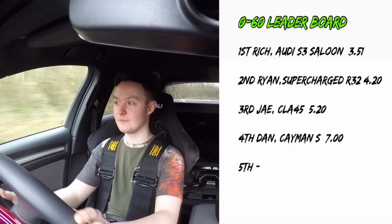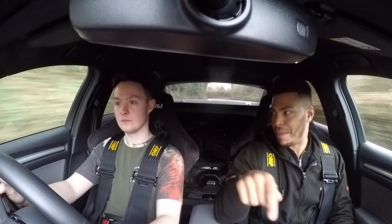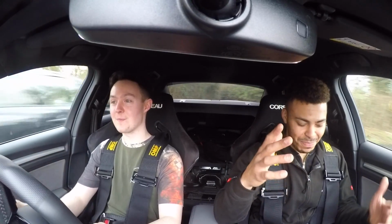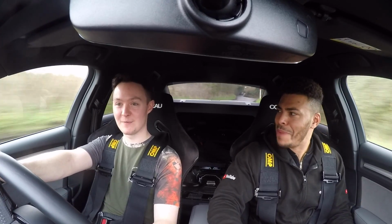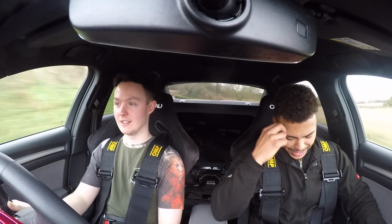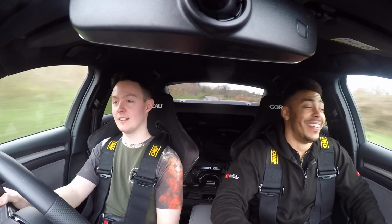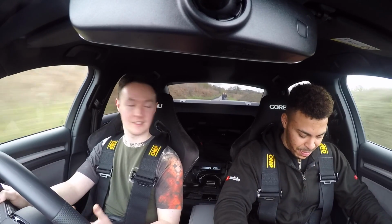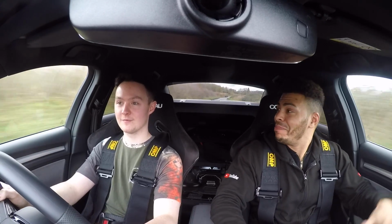So he's just done a 3.51, then a 3.61 in the damp with pretty much slick racing tyres on. Bro, your car is absolutely a weapon. The way this launches, making my car look bad, man. And you're still running on a stock gearbox map. Yep, stock gearbox map. Once the racing line have uploaded the map, it ups the boost for launch control and increases the pressure on the clutch packs to around 19 bar, so I'll be able to get off the line a lot quicker. Jesus Christ, bro. Wow. Sick.